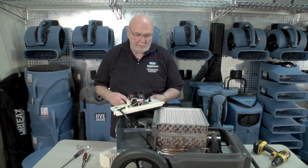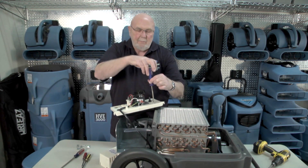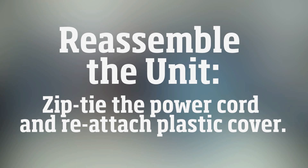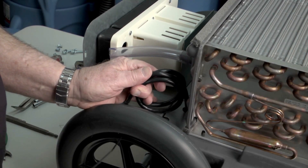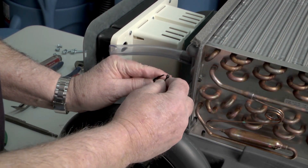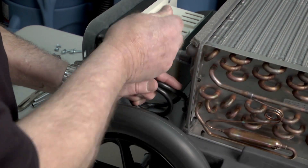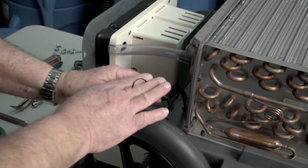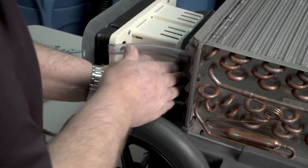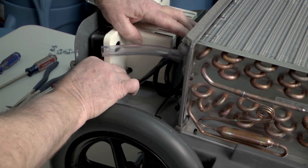Now that we've inspected the pump, we just need to reverse the process and put the screws back in. It is important when you go to put this back that you zip tie the wire. If you don't have a wire tie, at least make sure the power cord gets totally behind or above the pump on the back side. I generally tuck the cord up here rather than in here so that it doesn't force the pump up when you tighten it back down.